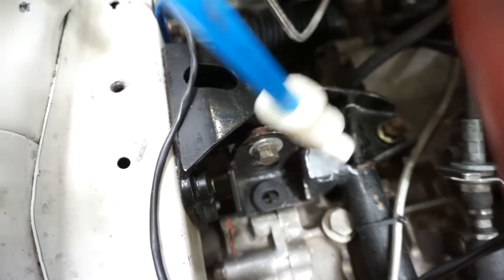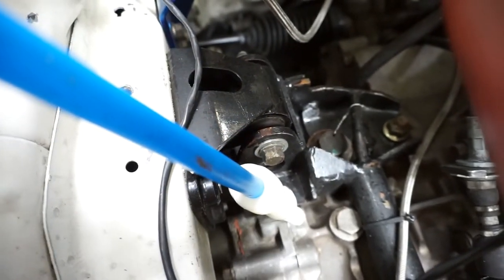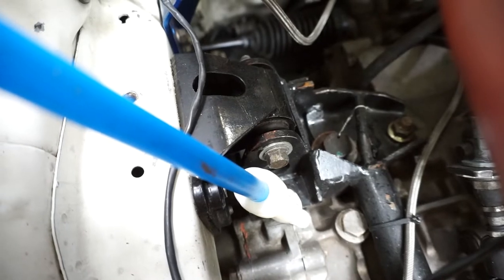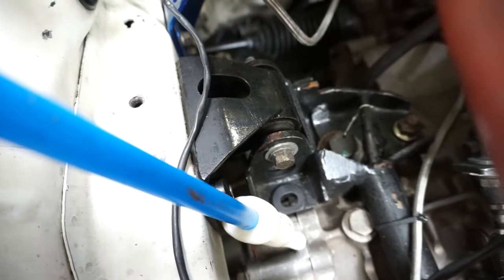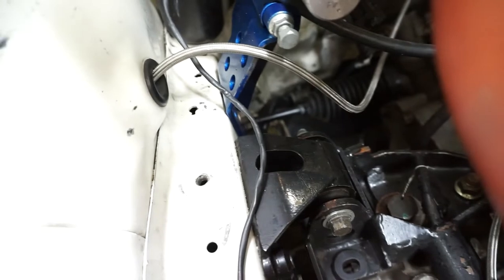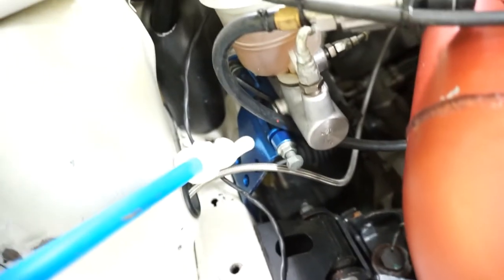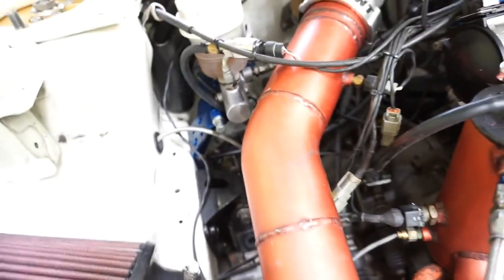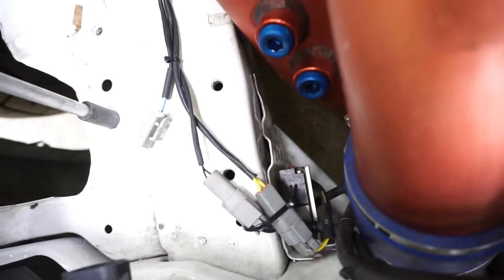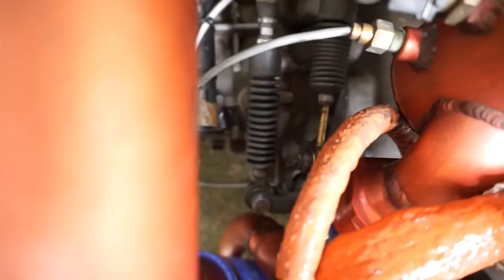Over here we have Group A engine mounts — or transmission mounts — and most of them are wire-tied so they don't come loose. Since this is a Gallant transmission, it bolts up to the Evo 1/2/3 a little bit differently, so I had to make some modifications here to make it all work. Cusco master cylinder brace — these Evos can be known for a cracking firewall if you put a really heavy clutch in after a long time, so it's nice to put a brace on right when you get the car.